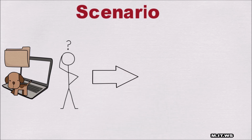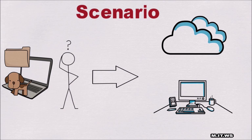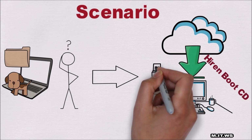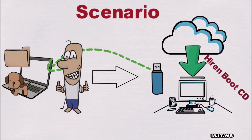Well, using another computer, whether a laptop or a desktop, in this case a desktop computer, you are going to download from the internet. I'm going to leave the link in the description below. We're going to download a free piece of software called Hiren Boot CD. After we have downloaded it, which is about 600 megabytes, we're going to create a bootable USB drive. Once we have created our bootable USB drive, we are going to connect it back to the laptop and start the process of recovering the password. Well, actually, we're going to reset the password, so the user will have access to his account again and will create a better password. So let's start.